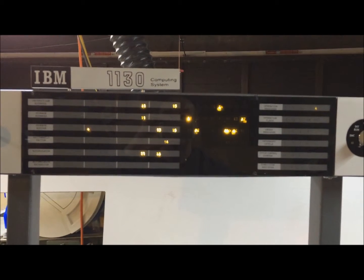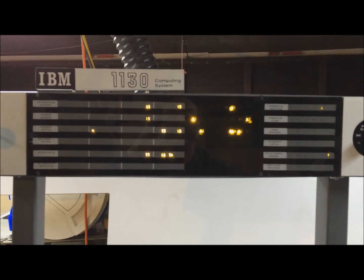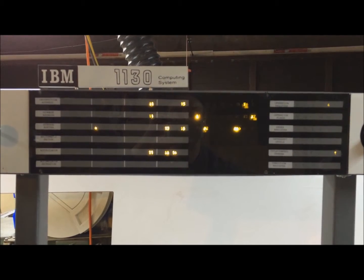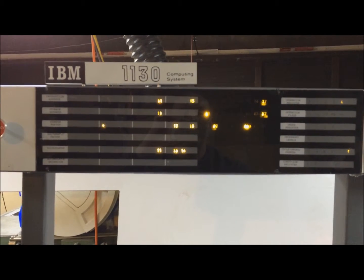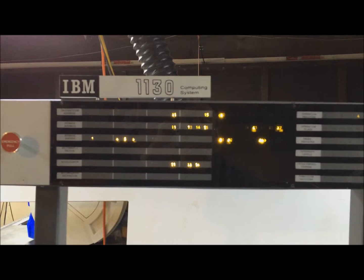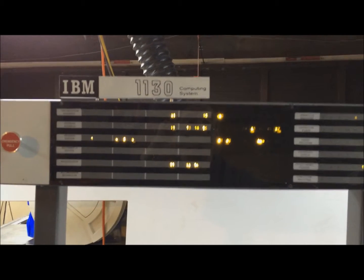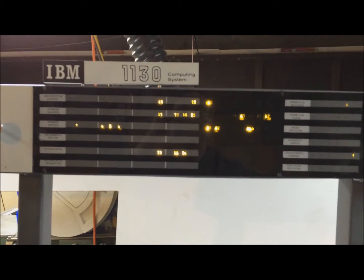So that XIO instruction is going to do a sense. We see it now beginning to pull up locations. It goes through T6, now it's in T7. You see the add status light is on, which would mean this will continue to do addition — but it didn't, so no rolling over was needed.